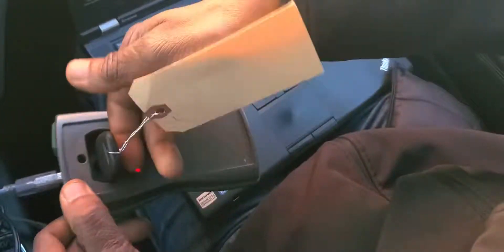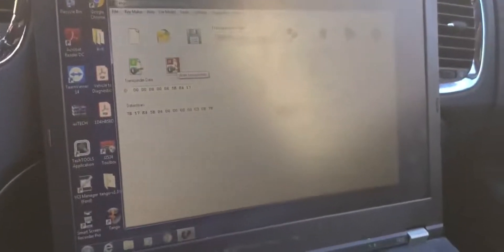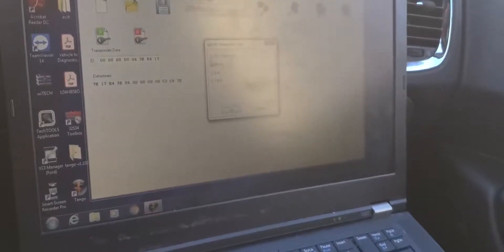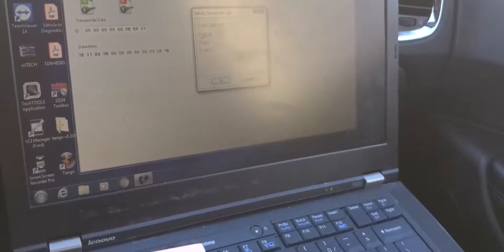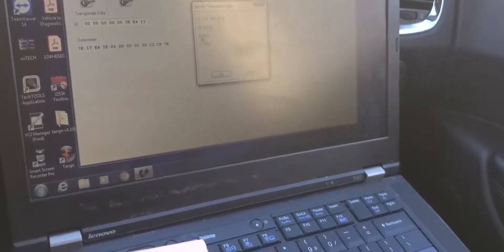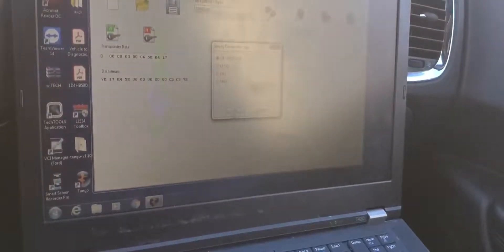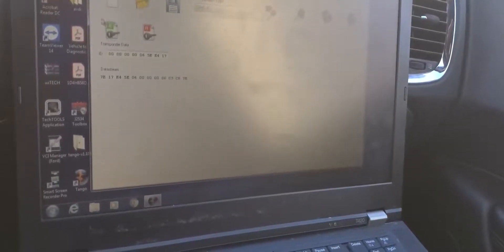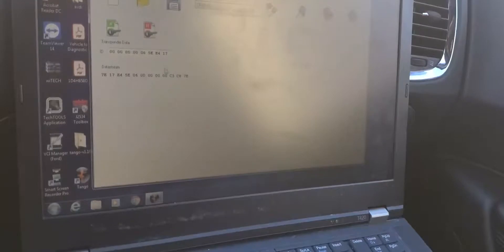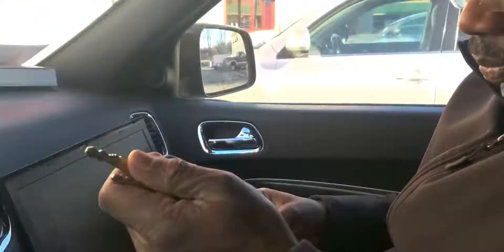Take the original key out and put in a CN1 chip. You can write to chip types CN1, CN2, YS-01, LKP02, EHS, or TPX1. I'll write to the CN1. Click okay and start writing. When you read it back, it shows 17 — that's it. Take this cloned key, put it in the ignition, and the car starts. Now you have two keys.